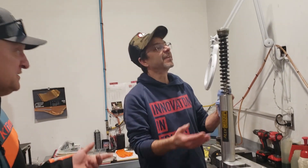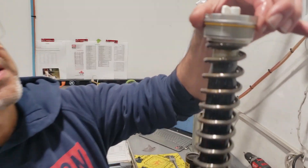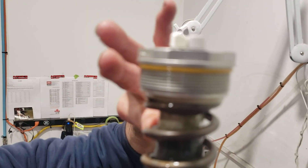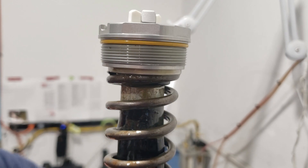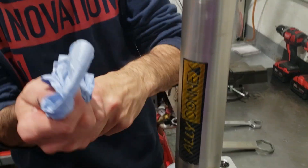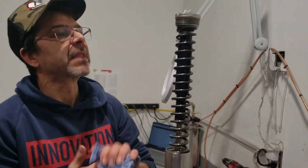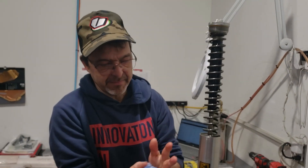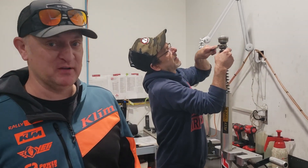Which is exactly the case. You can see if you get in there — you can see the slime and you can see the rust on the spring, and the oil is kind of milky. So it has gotten contaminated with water. Get that sorted out. It's classic — I just called him up and said, hey, we're just changing springs. No, looks like we're doing oil too.